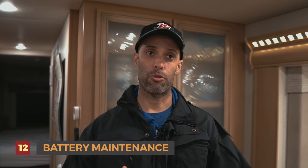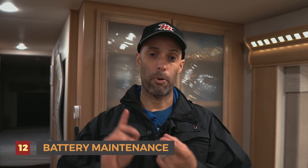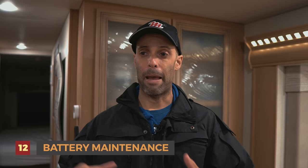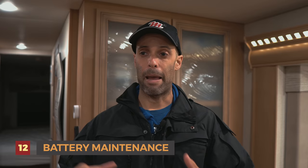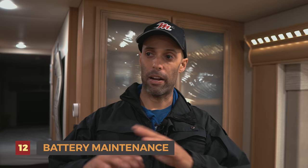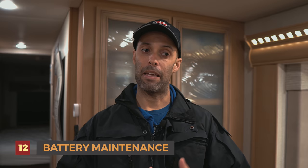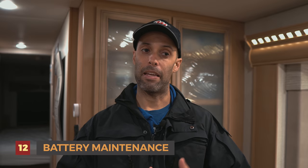Number twelve is maintaining your batteries. We did a detailed video on battery maintenance — we'll link it above — but what's important for winter is that you either want to be plugged in, which we're fortunate to do at home with 50-amp service, or you want to put your batteries on a trickle charger. If you're in storage with no power, disconnect the batteries and ideally remove them and bring them home to a trickle charger. With lead-acid batteries, there's almost always some parasitic drain on an RV — something will still drain the batteries. If they drain down to a certain level they're done, so to avoid that costly mistake we suggest either staying plugged in or completely removing your batteries.